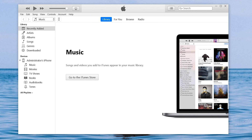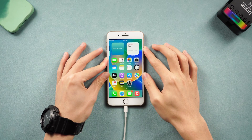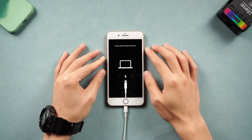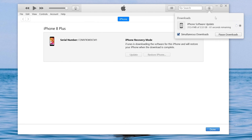To factory reset your iPhone 8 with iTunes, there will need an extra step: put your iPhone 8 in recovery mode. Press the volume up and volume down button, then press and hold the power button. Keep pressing till the recovery mode screen shows up. Then you will see iTunes pop up a window — choose the restore option. Then iTunes will begin to download the firmware. When the firmware is done, it will start restoring your iPhone 8. But sometimes iTunes or Finder will encounter errors, which is annoying. The download and restore process is also very long, so I will skip them.